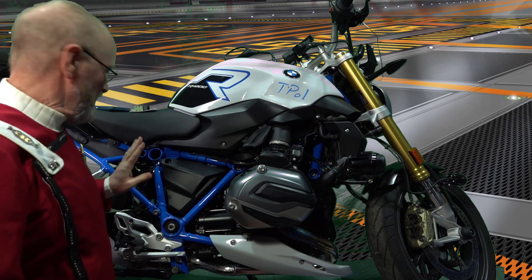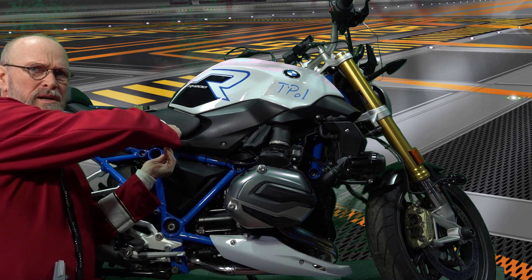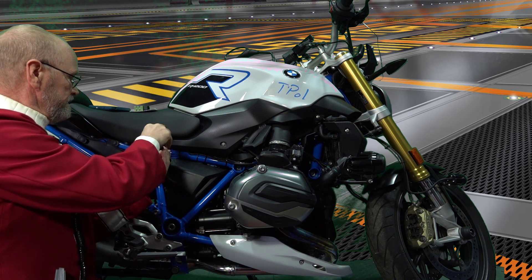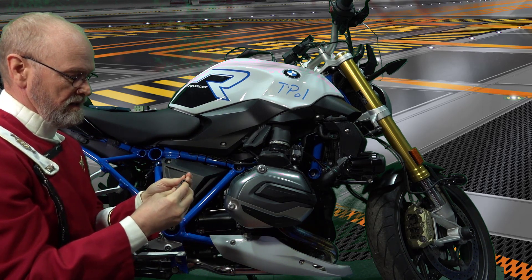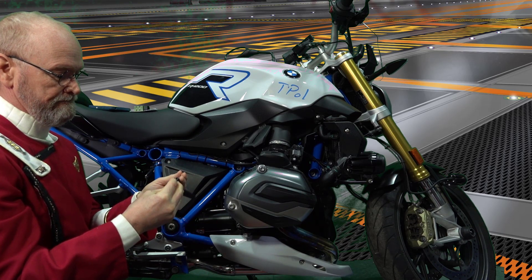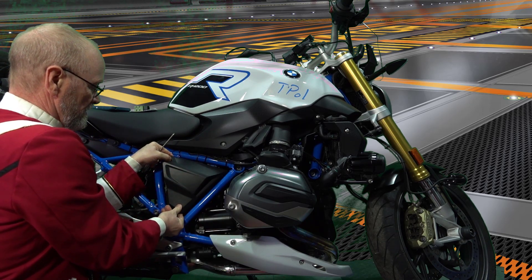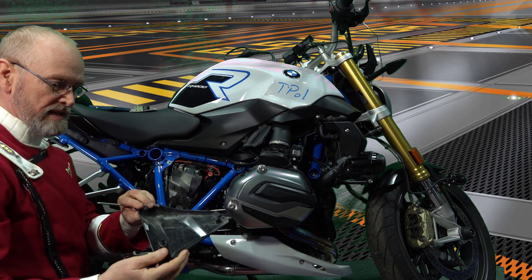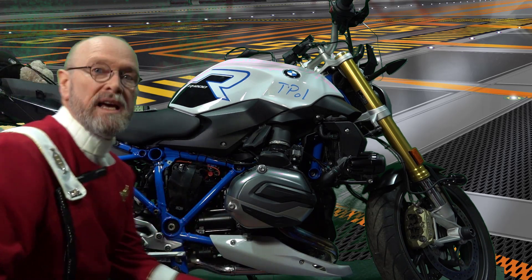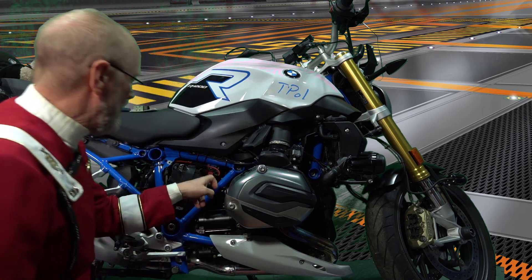Here we are. Let's have a look — this is the battery cover. So you're going to need a screwdriver. We're going to undo this one screw, and this is a Torx T8. This has two little rubber connectors, so you just gently lift it off. You can see that they just pop off — one's a locator and one's a connector. So we'll just take this and put it aside. Now we have our plug right here.